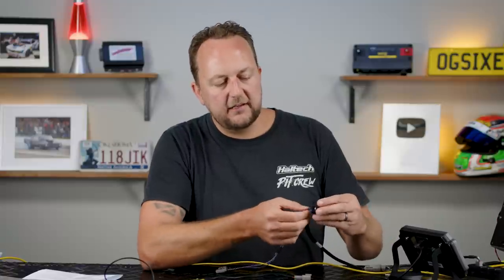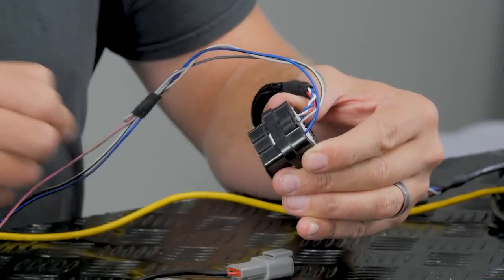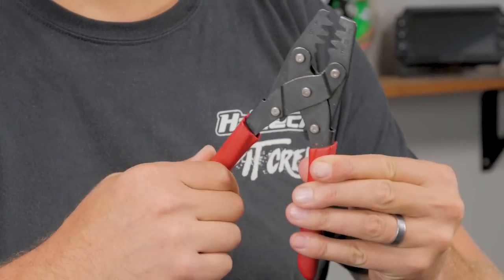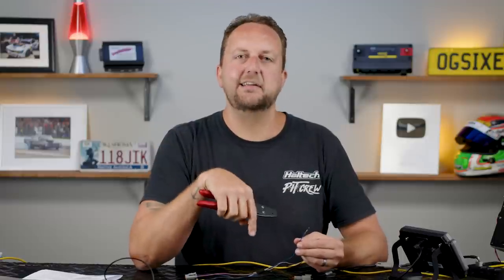On the other side of this wire, just for this demonstration, I've pinned these straight into the dash plug itself. All I've done is pull the 34-pin connector out of the dash, used my fingernail to snap the big white connector on the bottom, which opens this AMP 1mm SuperSeal plug, and I can then pull pins in and out of it. These are the crimpers I've used — also available on our website. If you're crimping ECU pins into your dash or ECU or any brand of engine management system, please use the right crimpers. There's no substitute — you can't use pliers and it's not a good idea to try and solder onto them. Please use the right crimpers.